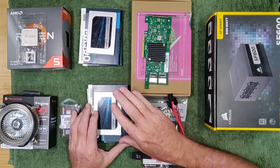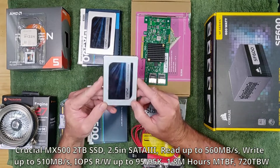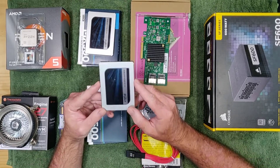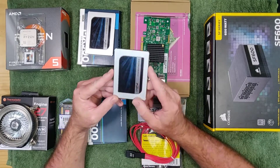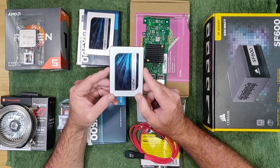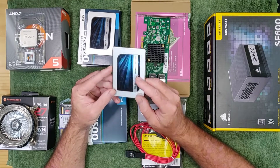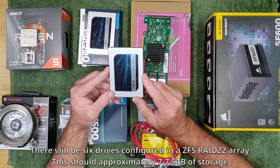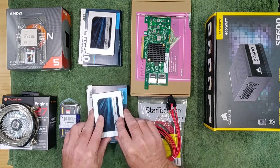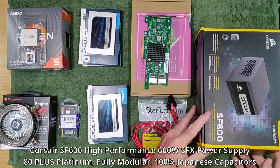For our storage drives we are going to be using the Crucial MX500 2TB 2.5-inch SATA SSDs. Again, these are consumer grade drives with 1.8 million hours mean time before failure and with 720TBW of endurance. I would have preferred NAS-oriented drives with a higher TBW, but exorbitantly high prices for really low capacity and a general lack of availability drove the decision to use these drives instead. At the end of the day there will be 6 of these drives configured as a ZFS array, which should give us about 7 to 7.5TB of storage.